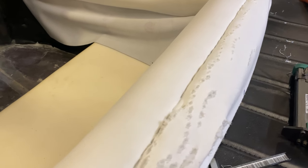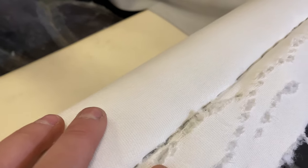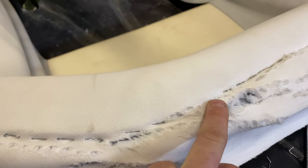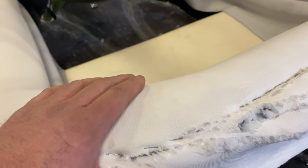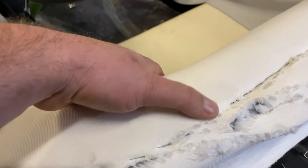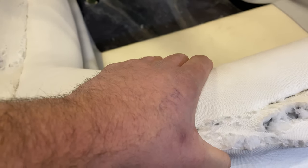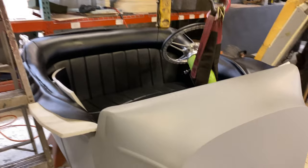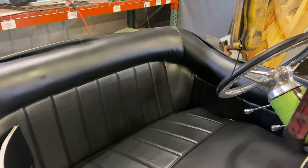What I'm doing right now is cleaning this up. I use bigger staples because the bigger staples bounce back, making them easier to remove. Now I'm going to put smaller staples in since it's pulled tight consistently. What I do is pull like two to four staples out at a time — you don't want to do more than that because it could shoot backwards. Whenever you pull the staples out, you always want to keep your hand firm and hold it so it doesn't go back. Then I'm just going to roll this back a little bit and staple it in.